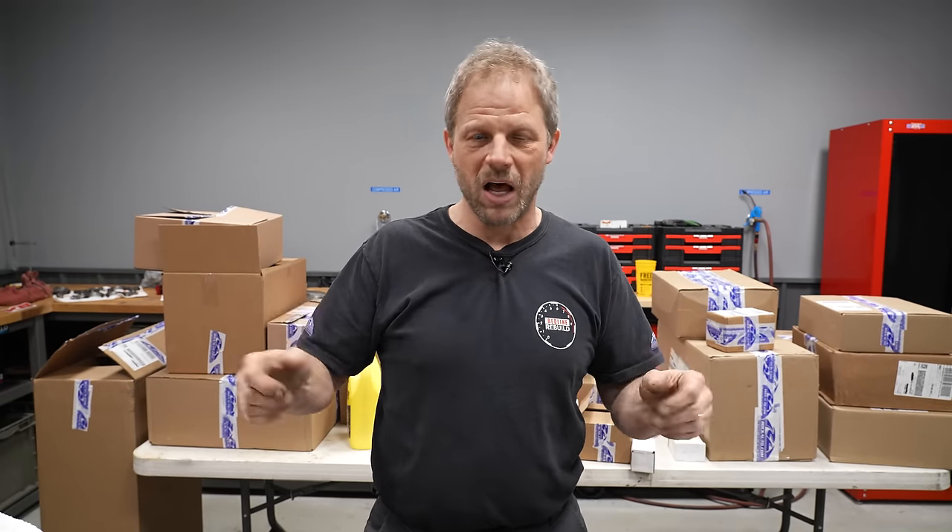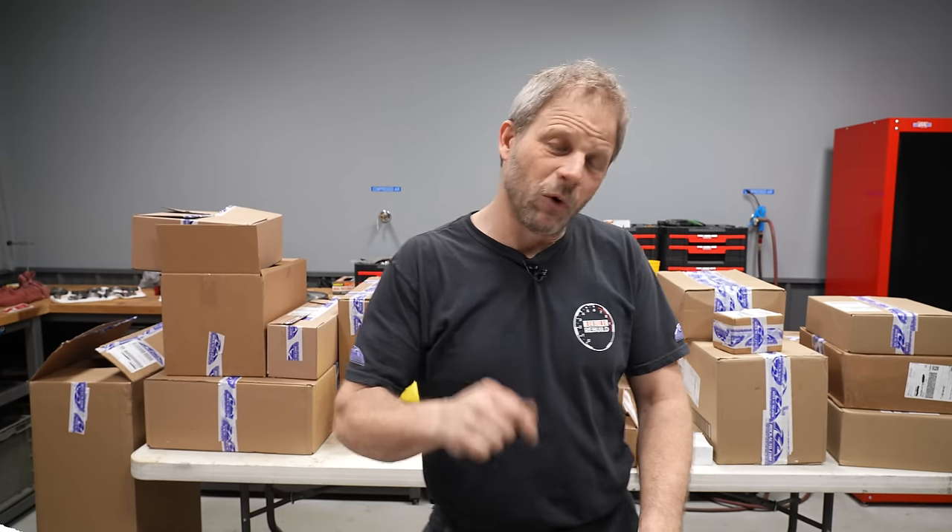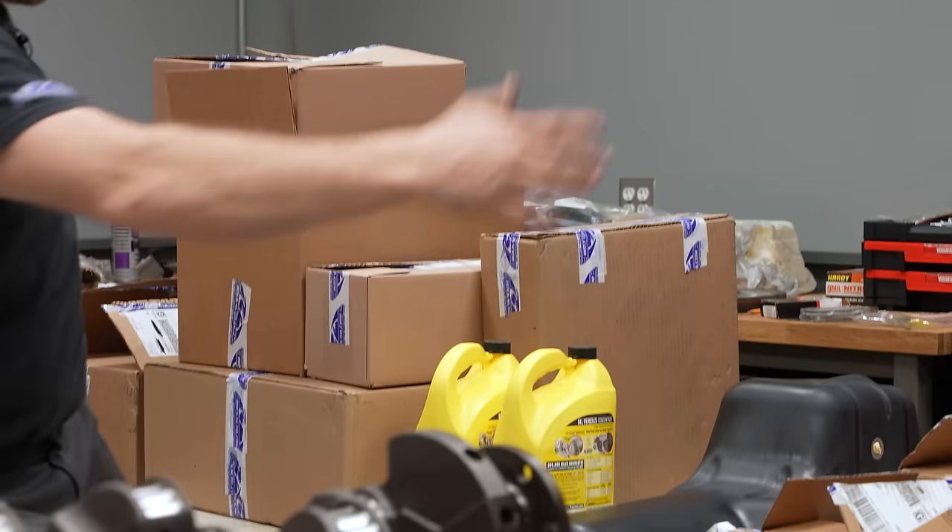In fact, one gentleman caught my ear when he said you need to put a 4.2 liter crank in it. I was thinking all along I wanted to do a stroker Jeep motor, but all I was ever thinking was I need an aftermarket crank. Now's really not the time to find that type of stuff, but when the guy said 4.2 liter, I thought — hold the phone. Are we just mixing and matching stock parts? Because I can get a whole lot of stock parts from RockAuto.com, and lo and behold, we have a lot of parts.